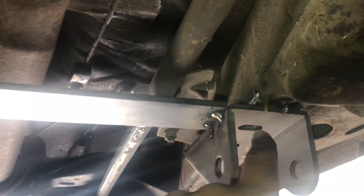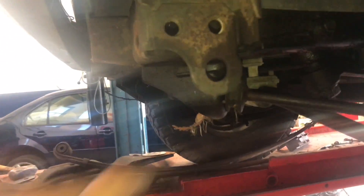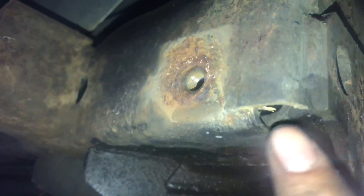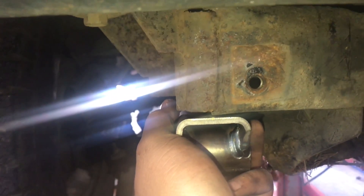The jig makes the 29-inch on-center part a lot easier. I put it where I need it, then I'll fully weld it, weld the hangers on, and then break the tack weld off here so the crossmember rigging will be out of the way. I'll just have to make some little triangle supports for the part that hangs toward the center. The front shackle hangers we're gonna have to cut off because they're kind of in the way — from this union here to the other side measures 29 inches.